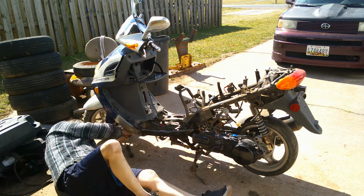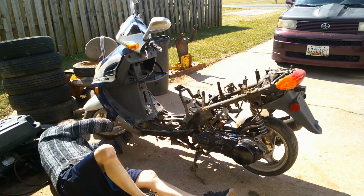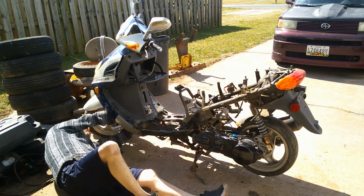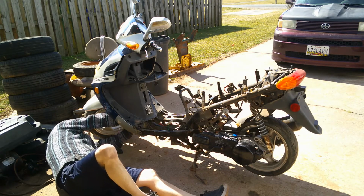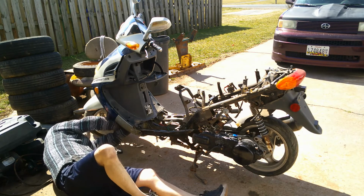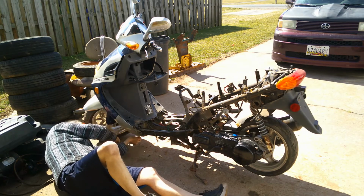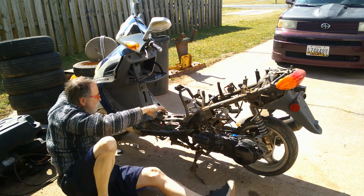They're bolts. 10mm, kind of long. They're probably 1.5 inches. And it seems like they're loose, so definitely someone was working on this before, because these ain't tight. I know they could have loosened up from factory, but not this loose. I could literally almost turn it out with my fingers, which I am right now because I dropped it. It's just hard to reach into it. There ain't a lot of room. There's the second one. That's loosening the whole front fairing out.